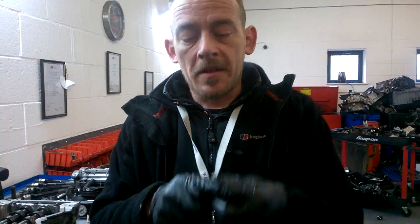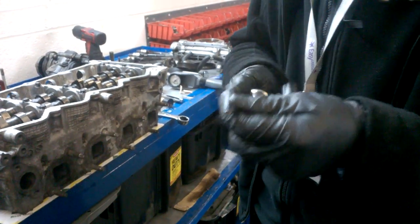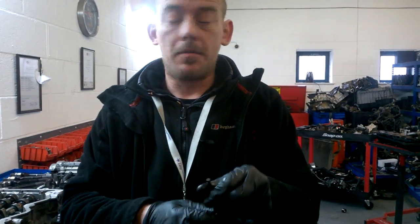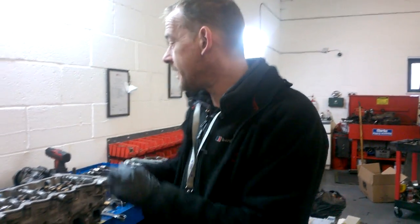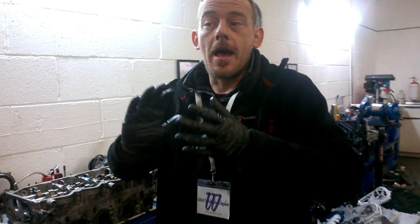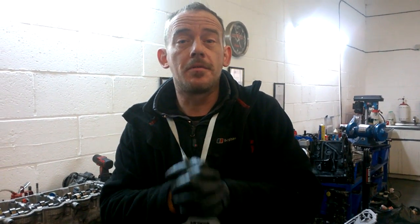On the bench grinder, slowly as you move the valve towards it, twist the valve so you get a nice flat cut. That's how you do it — quite simple. The only thing is it's time-consuming because you've got to keep putting the valves in and out of the cylinder head. So that's the cylinder head covered, and the next video will be a warranty claim for Nissan and the 2010 engine — thanks for watching.